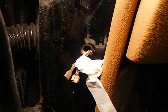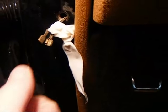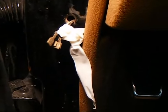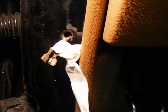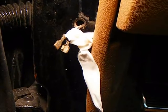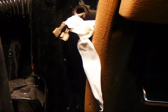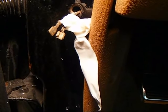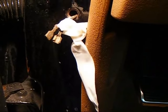One helpful tip: we've taken a piece of tape and put it around each one of the wires. If for some reason that wire falls back into the hull of the car, you're going to be in a world of hurt — you'll have to pull the kick panel and do a lot of unnecessary work. Just wrap each wire in tape and leave a long pigtail. Even if it slips in a little bit, you'll be able to fish it right back out.